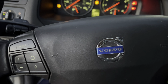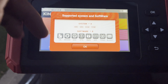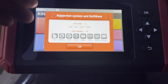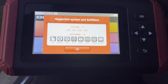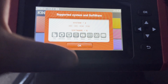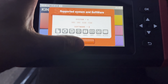As we connect the scanner to the vehicle, we do have our check engine light, and we need to be in position two in order to read codes. The systems this car can check include ABS, SRS, ECM, and TCM - basically your brake system, your safety restraining system, your engine control module, and your transmission control module. There are eight resets: oil maintenance light, brakes, steering angle sensor, electronic throttle body service, battery calibration, DPF filter, TPMS, and brake bleeding.